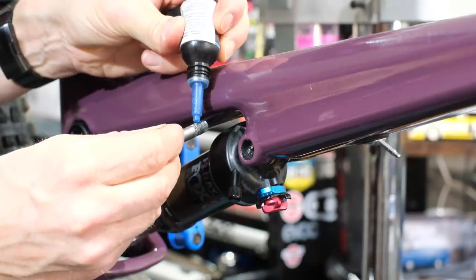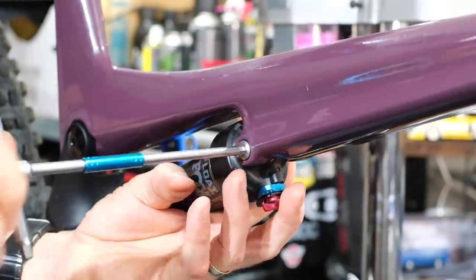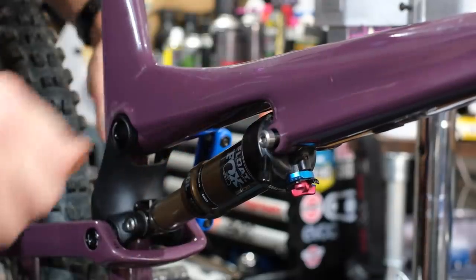When was the last time you checked the back end of your bike? In particular, your suspension hardware bolts, your pivots, the shock bolts and mounting bolts — probably not often enough. Of course we all do a safety check here and there and run an Allen key over the bike, but some things come loose without you realizing. It's moving parts after all. Some of this stuff comes loose because it hasn't been tightened sufficiently, some because there's no thread lock on it, and some will just naturally vibrate loose due to the way you ride, especially on rough terrain.